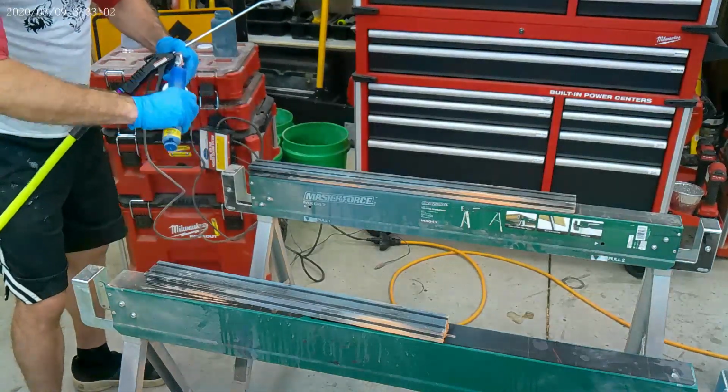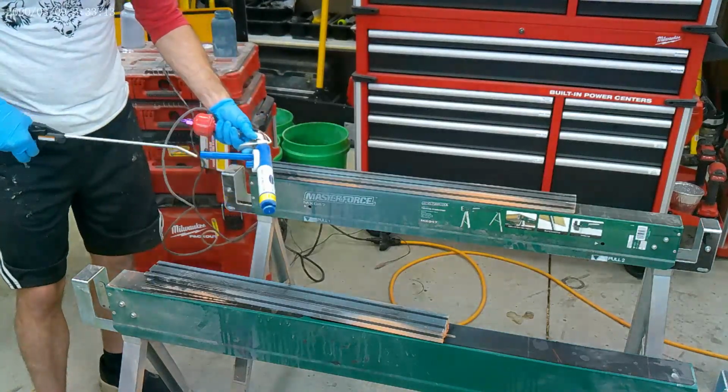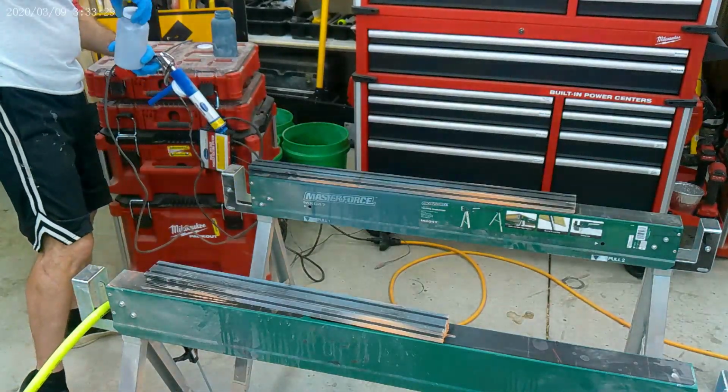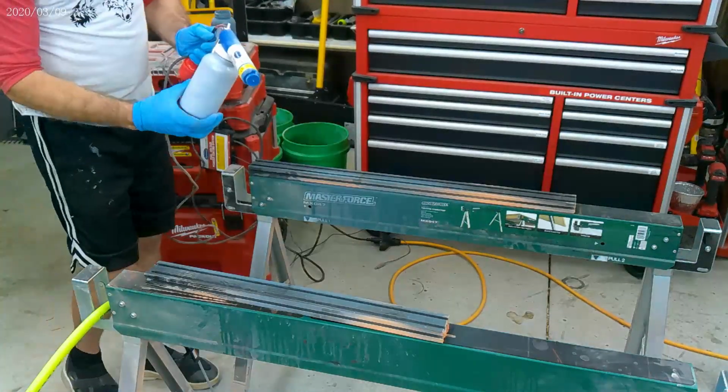So the final result I want on this intake is copper penny, but to get there you need to do a base coat underneath of a chrome powder that gives it the bright shiny. If you didn't use that chrome, it kind of looks like a turd orange.